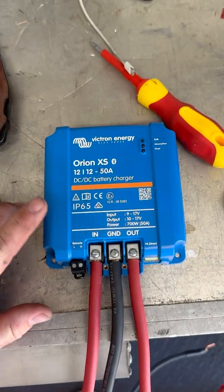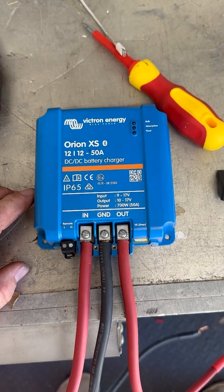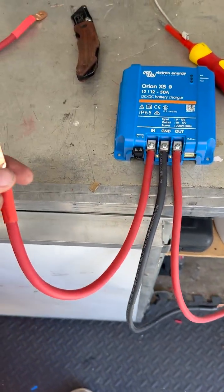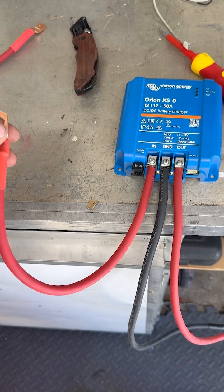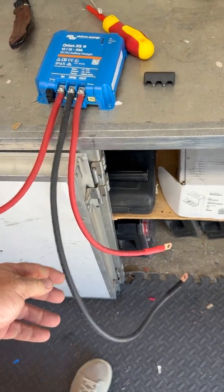You're pre-wiring a 50 amp Orion XS DC-to-DC charger. You can do a lot of that already inside your work area before you get into the rig. You do need to measure though, so we measured. We know that this one, based on where we're actually going to mount it, this cable will easily reach where the alternator battery charging is coming from — from the coach ground chassis.